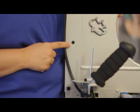Clockwise rotation on the screw will slow the positioner down; counter-clockwise will speed it up. Since we have the Energizer Bunny who keeps going and going, we need to slow the positioner function down, so we're going to turn this screw clockwise. It may take two, three, sometimes even four revolutions to get the position set correctly. The ideal time lapse for the machine to position is a full second — from needle up position to needle down position. Whatever adjustment it takes on this little brass screw to get the machine to take a full second from needle up to needle down, that's what you're looking for.